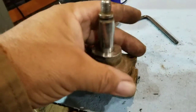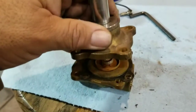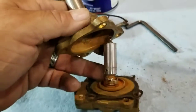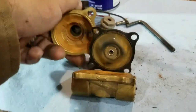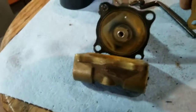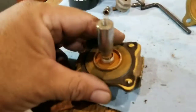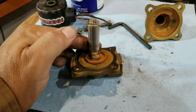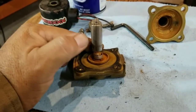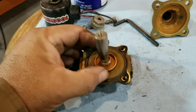If we unscrew these screws carefully, because there's basically a diaphragm in here — you take this off and you'll see that there's a spring and a spring and all kinds of rust. Rust is going to be your enemy. This is why a lot of people say to get air dryers to put on your system right after the compressors. The compressors are going to be pushing moisture into your tank. If you can eliminate that moisture going into your tank, you'll eliminate a lot of this.